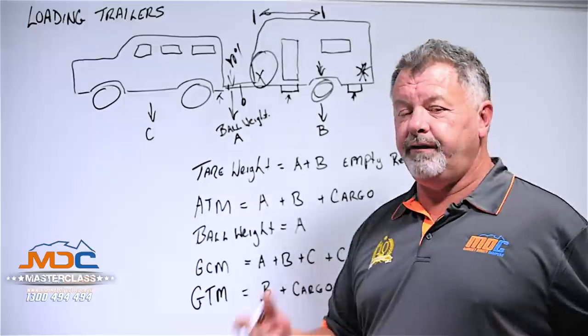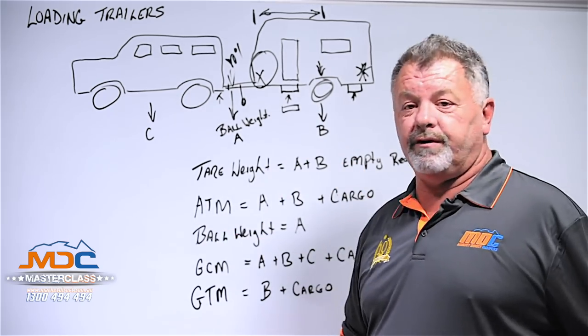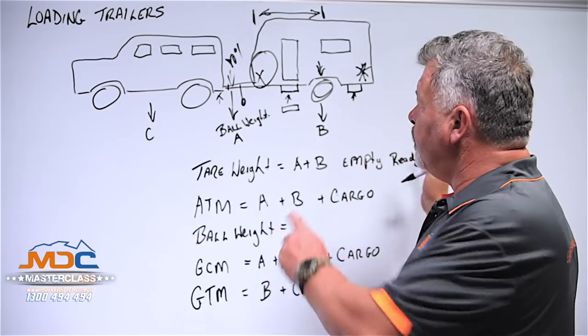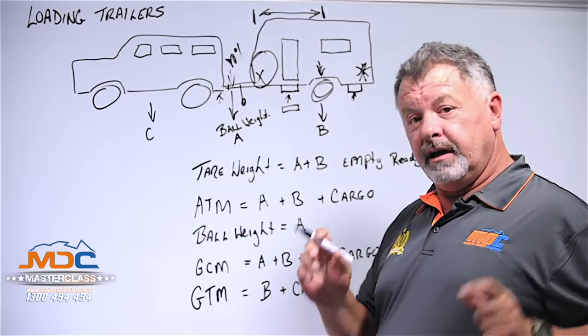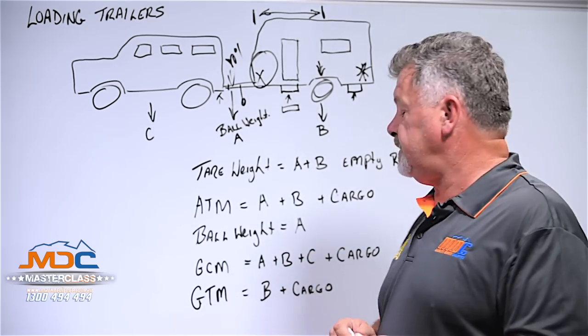And if you've got a greywater tank, think about where that's fitted. When we go camping — out in the bush for a couple of weeks — we've emptied either or both tanks, we've filled the greywater tank, we've shifted the weight around on the camper or the caravan. Keep that in mind and make any adjustments necessary to keep the handling good on your trailer.